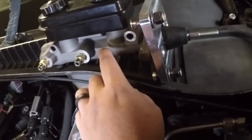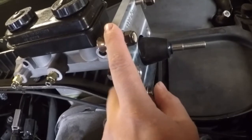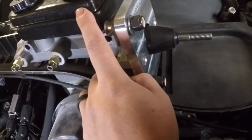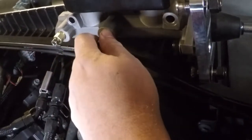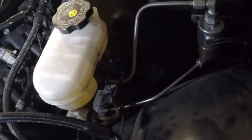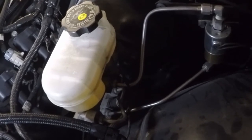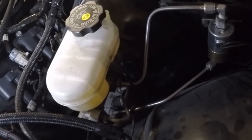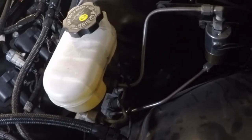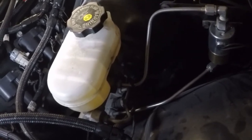Then we'll go over how I'm going to install the TRZ manual brake master cylinder kit, which in all honesty is just some hardware, an aluminum plate that makes up the difference, and basically an off-the-shelf master cylinder. I've got to figure out the brake lines — TRZ sends you these 1/2-20 inverted flare fittings to 3/16 brake line. But from the factory, everything up here is quarter-inch brake line. This is where the how-to might stop for those of you with more stock Corvettes, but I'll show you some tools and methods to hopefully make that process easier.